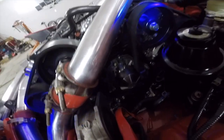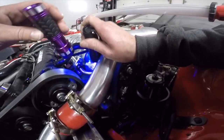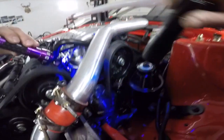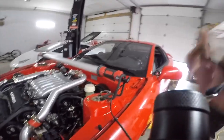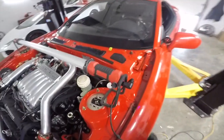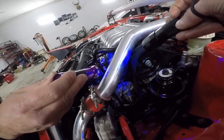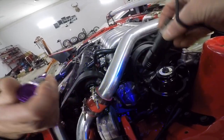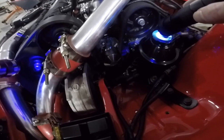All the cam seals got just a little bit around them, which isn't horrible. Yeah, all the intake runners are soaked. So where's oil coming from the intake side? Or the cleaner that we use to clean those intake runners is glowing? It makes no sense. Look, so even old oil glows a little bit though. So this is kind of useless. I still don't see anywhere profusely spitting oil out, you know what I mean? Yeah, nothing's like... Things are wet, but not... And I think a lot of it is just left over.